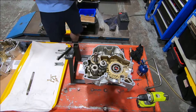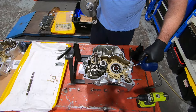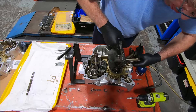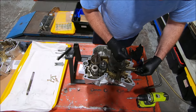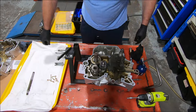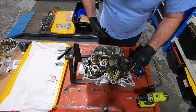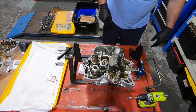Now the crank shim — only one side — and the rods. Make sure they're poking out the right holes; getting that wrong was a real doozy. And the timing shaft. I usually give the bearing and the seal surface a bit of a spin in the lathe before I put them together — not sure if it actually does anything or just makes me feel better.